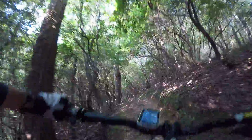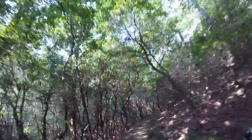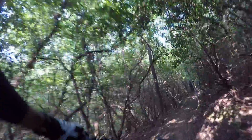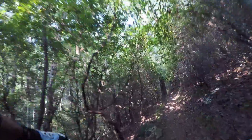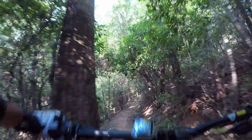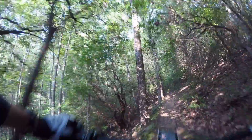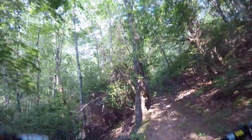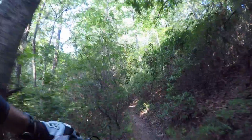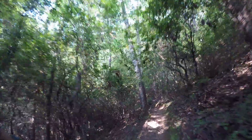Like I said in the opening video, the first look of this bike, the shock is a little soft in the mid-setting, and so staying in the saddle is the best way to climb. I could probably put some volume spacers in that shock. I've actually never messed around with volume spacers in a rear shock, only the front. I might end up trying to firm it up a little bit. You don't want to add too much PSI because then you lose the suppleness of the shock. Still want it to be small bump sensitive.